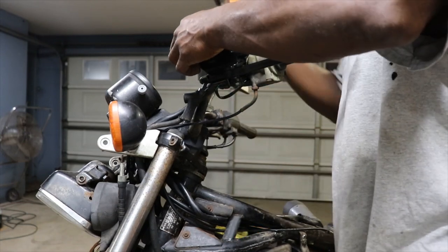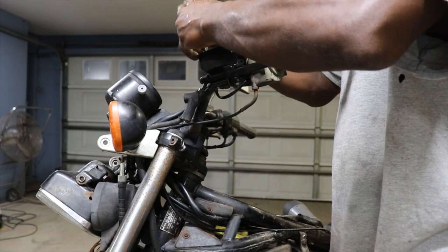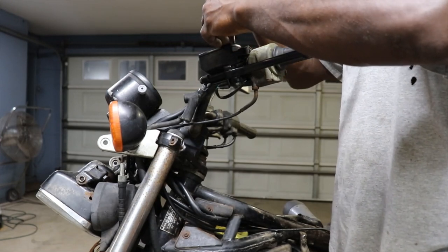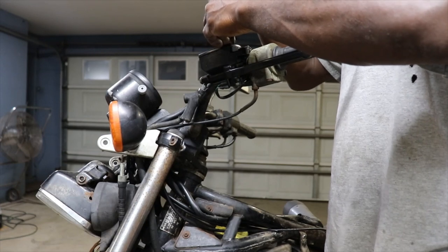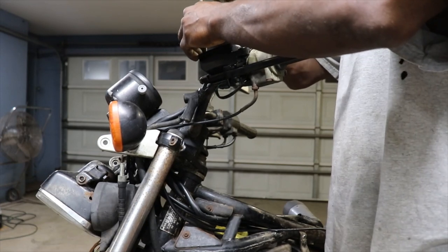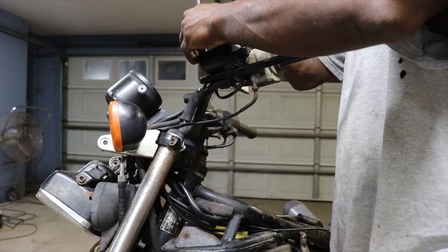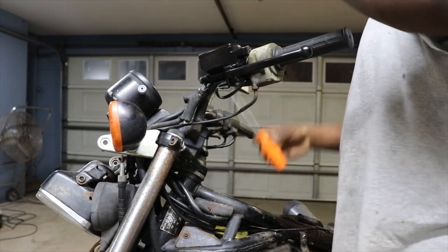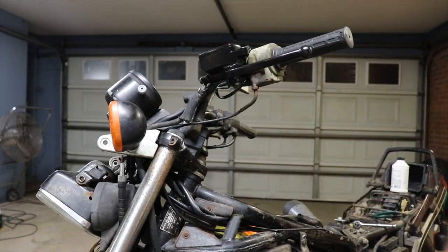I tried to clean it out, blow through it, and couldn't get the air hose to go inside of the brake hose where the banjo bolt goes, to seal it off to get enough pressure. So...